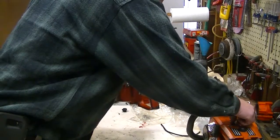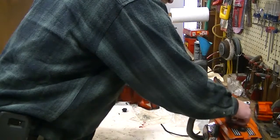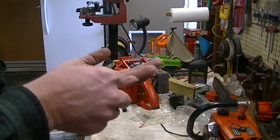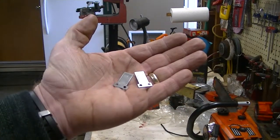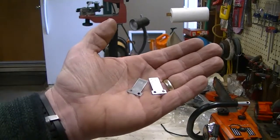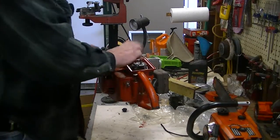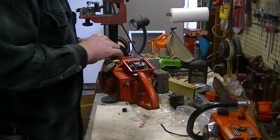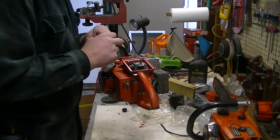The first two things I came across were the reed valves. I had overlooked these because it was so slight. I'm going to see if I can get the camera to focus - you see the dimples? Those things weren't seating flat. Evidently when the rod went in this thing, it actually sent some debris back up the intake that managed to smack these reed valves and put those little dimples in them.